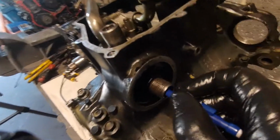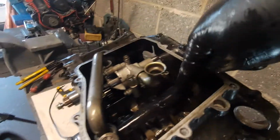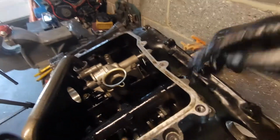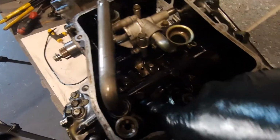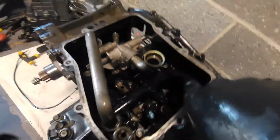So moving on with that, we're now in this chamber. Now this chamber, through there, you can see it's been bored. Hope you can see that through there. And we've got lots of drillings coming into that, okay, but it's essentially this bar in here. And as you can see, the crank is down there. So when we split the cases, we'll be able to see it. But this is a pressurised chamber. And there's one of them going to that big end. There's the two, that main bearing, that main bearing, that main bearing, and then main bearing at the end.